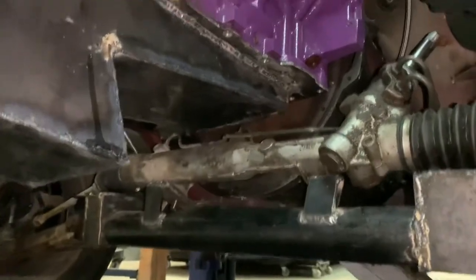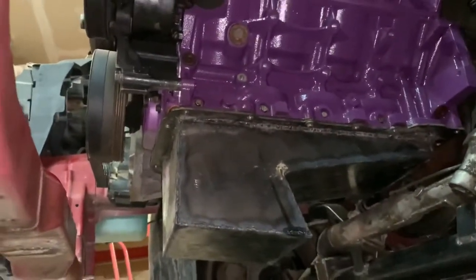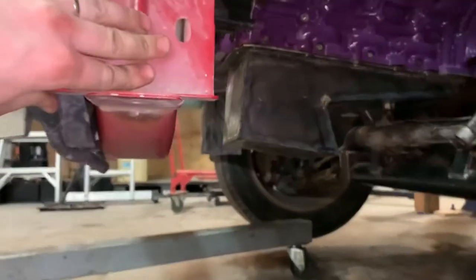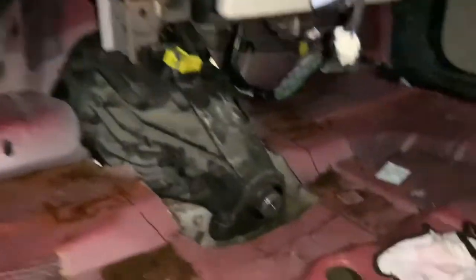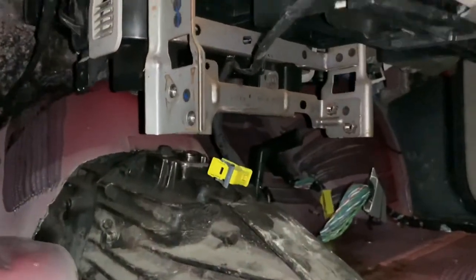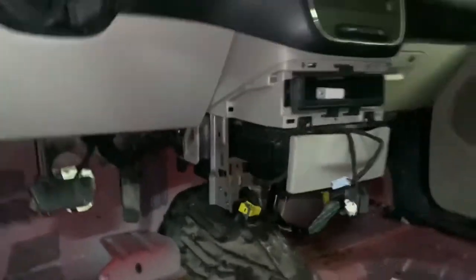I'll probably jack it up a little bit more. This second line over here is actually on the other side of the oil pan, so that's not a big deal. We got a half inch or so between the power steering line here and the oil pan — it's not touching anywhere up on the firewall. Obviously lots of room. Our oil pan is actually pretty much above or level with the cradle right here, and the cradle back here is actually lower than the pan. Transmission back here has piles of room — it's up in the floor, which is to be expected, not a big deal. It's gonna be a hard time getting the shifter to come out in the right place — looks like it's gonna want to come out through right where the cup holder is, but if I can make a drop bracket, I'll do that. I'm not moving the engine around the van — the van is gonna have to move around the engine. When it gets in there, it ain't moving.